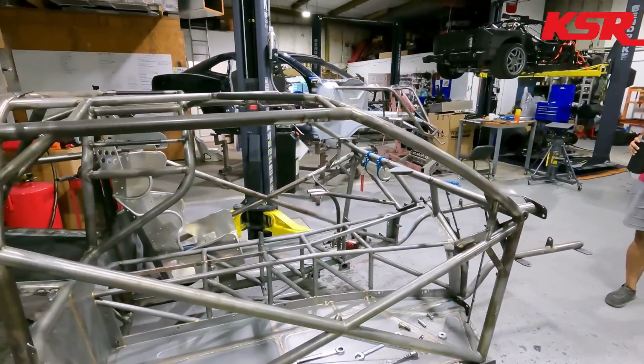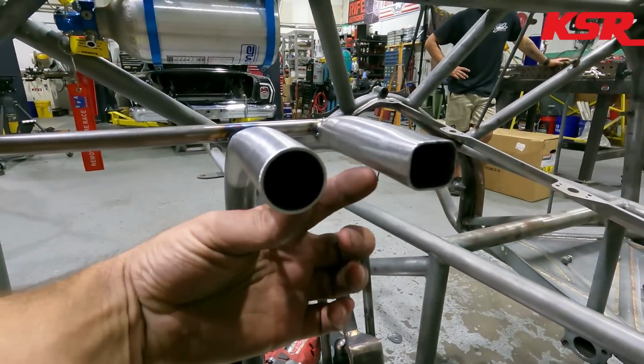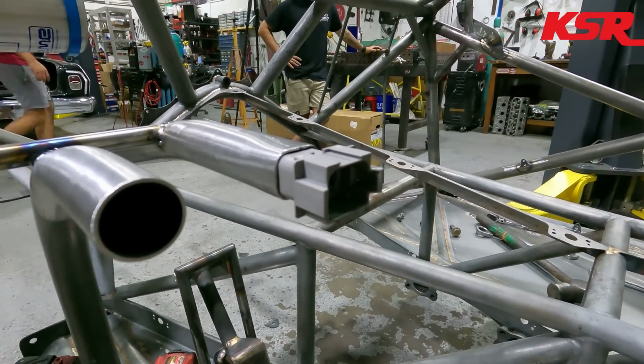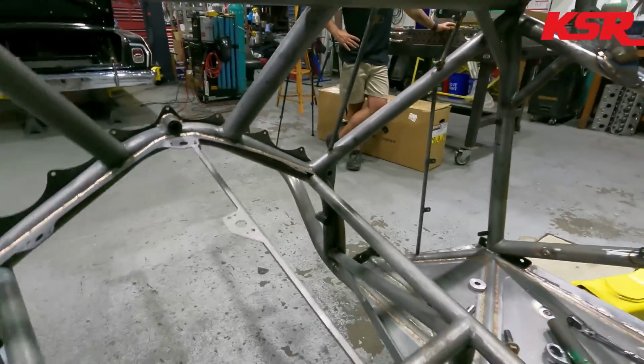That is just cool. And I teased you guys earlier on the weird shape of this extra steering column bracket, right? So there's still some tabs that are going to go here that will give us the adjustability for the steering column. Part of the reason it's done like this is to make it easier to keep the dash in one piece, because the steering column goes under the dash. So there was no need to make the steering shaft or the steering column go through the dash and mess all that up. But this is going to be the wiring for the steering wheel buttons, and they will go down and come out right there, and then go over to where the ECU is over there. So, little tricks we're trying to do to keep this thing as clean as possible.